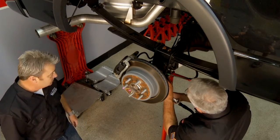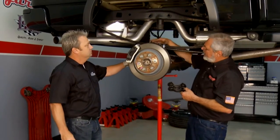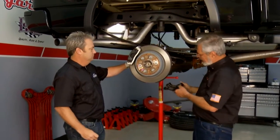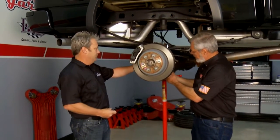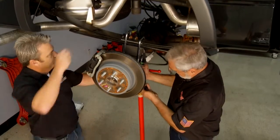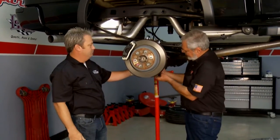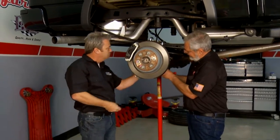We can see the new spacer block is in place. Here's where the new U-bolts go — you get hardware, nuts, and washers with the kit. Put the retainer on the bottom, then the flat washers and nuts, torque it up, and you'll be ready for the shock. Let's go.